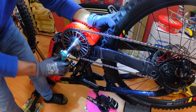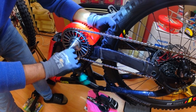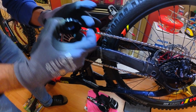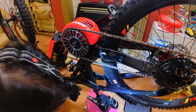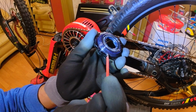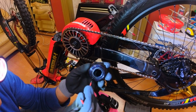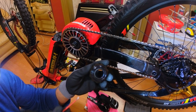Going easy, nice and gentle, no rush — let this thing come off. Keep that aside. Now the thing to remember is this has an O-ring. Sometimes this O-ring can snap; ideally you want to change that O-ring when you're having the bike serviced. The ID for the O-ring is 41mm, outside diameter 44mm, and thickness 1.5mm.